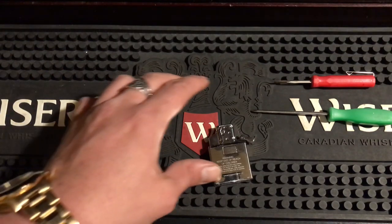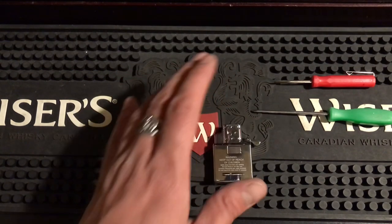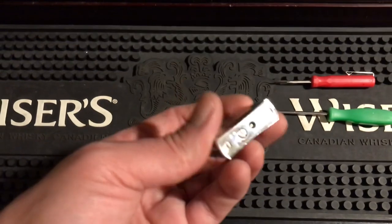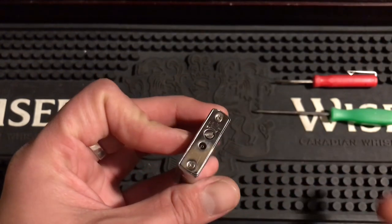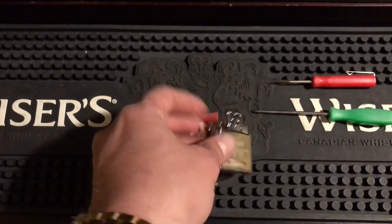Perfect, that's all I need. And I'm sick of filling that Zippo every week, every 2 weeks, and having to refill it and not even use it. So that is why I got the butane insert. These are not bad, these are good. But you will have to do small adjustments to it, fix them up, it's not a big deal. You've seen how easy it was, two screws, O-ring, governor, change it up a little bit, just turn it up, put the governor back on, and everything's gonna work fine. I keep that in my Zippo, it's all good.